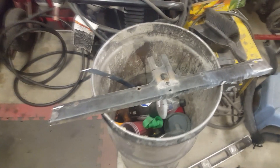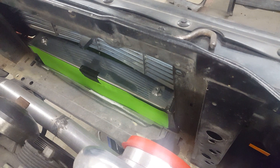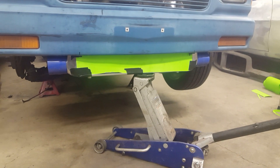I was barely touching them and squishing them with my fingers, so now I'm taking it all apart and cutting the rad support back about half an inch just where the intercooler sits. I have lots of room there — it's not a big deal. What I ended up doing is cutting that piece of the radiator support. You can see where it's ground down; I took maybe half an inch out of there, and now the intercooler fits into the grill area fine with the bumper and grill on all the way.